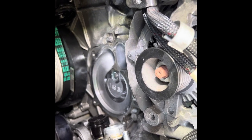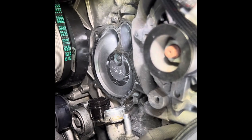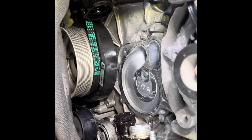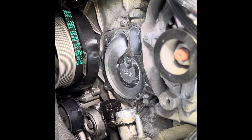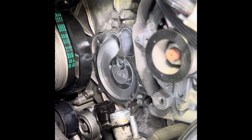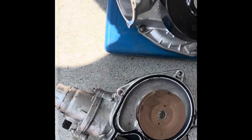The water pump definitely gave me a workout. These two pipes on the right — silver and black — the top is the upper radiator hose. The rubber O-rings were straight-up stuck on it, so it took a lot of persuasion and leveraging. I usually use a rubber treatment to loosen things up without damaging the O-rings. I sprayed a lot of it there, let it sit for a couple of minutes, and just worked it out.